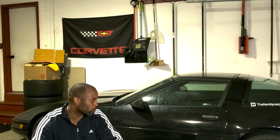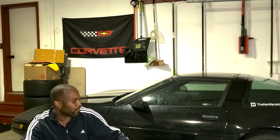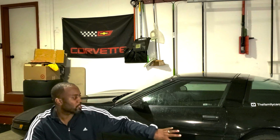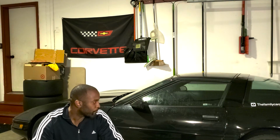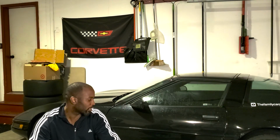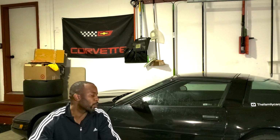But to get a modern set of tires to fit these wheels, which are 315/35/17, there's only a few tire manufacturers that are making tires in that particular size for the rear. And then in the front, we've got 275s. These are 17-inch wheels, obviously. So the Nittos, especially when they're a newer tire, do pretty well. As the tire starts to wear, which I've beat up on these tires pretty well, they've got a 300 treadwear rating. So they are a solid street tire.